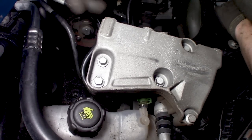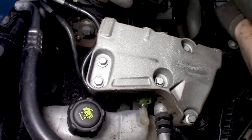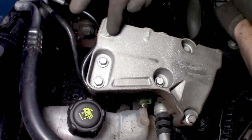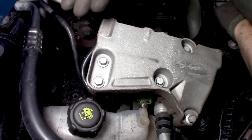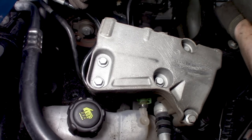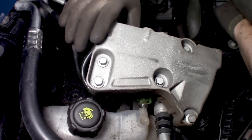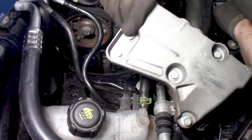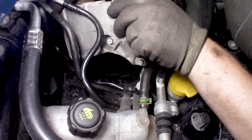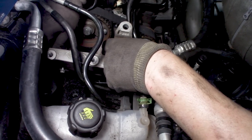I just snapped the belt into its place, just untensioned the tensioner and put it in there. It is easier to do it from below. Only thing you have to do is drop the engine all the way down. Then you can get to the tensioner better with the spanner. So that's my advice. Sorry I don't have it on film. I'm a bit in a hurry right now. I really have to finish this, and it's taking so much time right now.